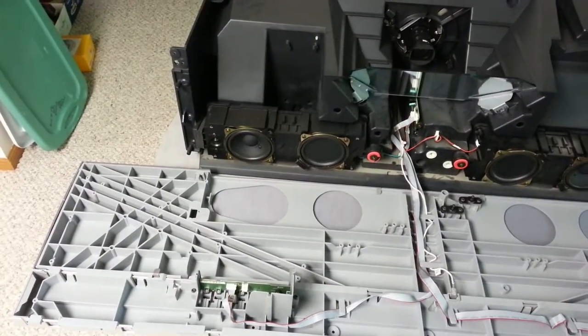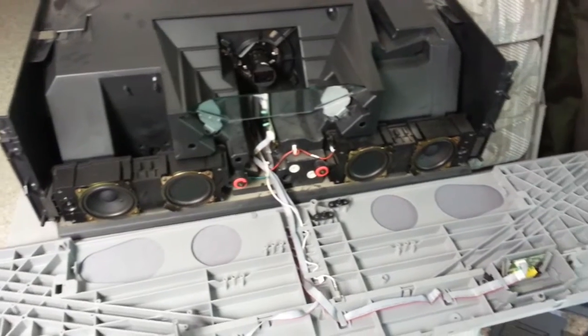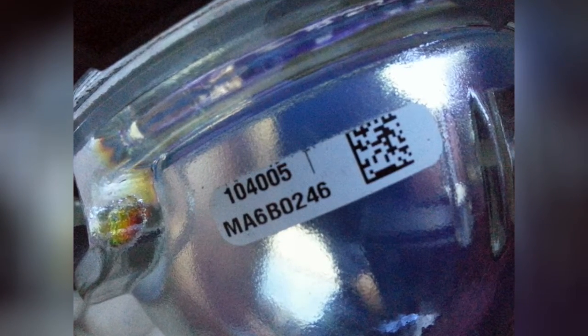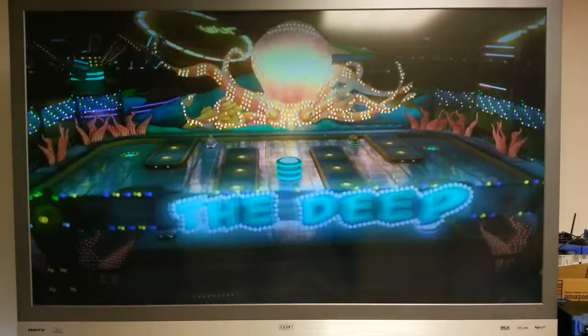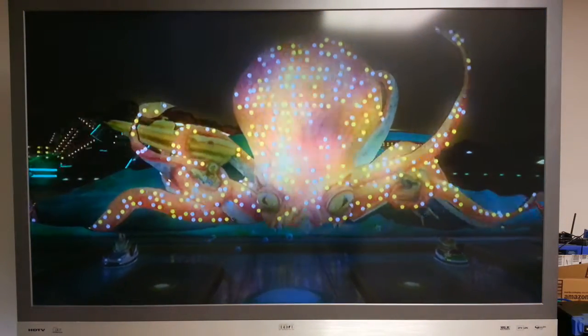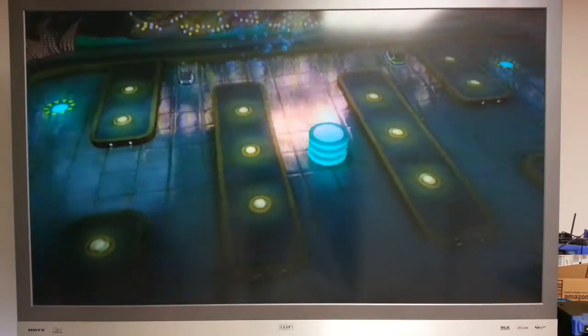After we arrived back home, I used the air compressor to clean out as much dust as I could and also cleaned the lower mirror inside of the lower cabinet. After I got everything back together, I ordered a new 260962 third-party projection lamp from a lamp store on Amazon.com, as I had done in the past with many of the digital rear projectors you've seen on the channel before, and it arrived a few days later. I installed it right away and the set powered right up, but it became obvious after this that there was another problem, which I go over in great detail in the technical video.